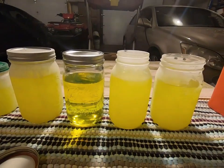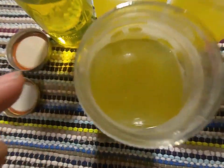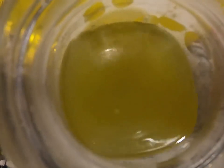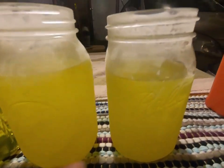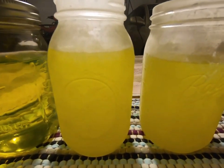I'm going to put them back in the freezer for another hour and see what happens. One of our plain jars is still pretty thick — you can see it doesn't ripple, it just jiggles. Whereas with the treated ones you can kind of see down in there, especially in the thick bubbles that are just thick diesel fuel. They both appear to be working a little bit. I'm kind of wondering about that ice sitting on top, so maybe that'll present itself a little bit more after another hour.